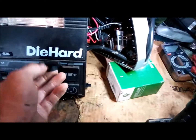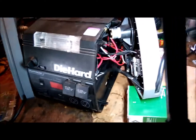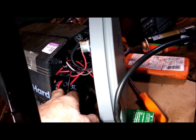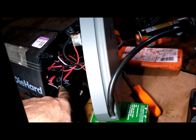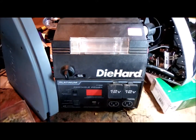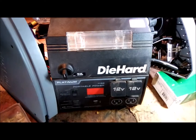Neither of those 12-volt sockets work and I haven't done a lot of troubleshooting, but I've got 12 volts at the battery. When I go across the socket terminals I don't get 12 volts, but if I go with my probe to the battery negative I've got power — so I've either lost ground or something else. There are a couple of 20-amp fuses in here; I'm going to check if those are blown, hoping it's just a fuse.